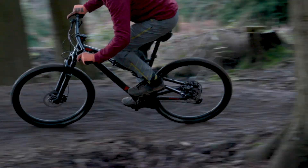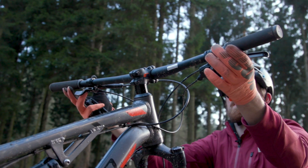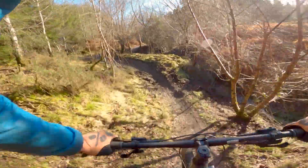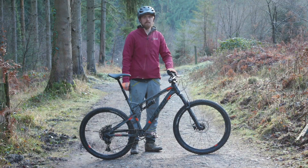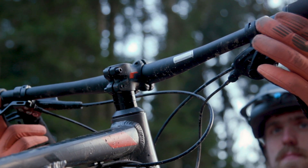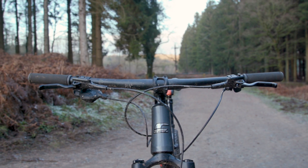The fourth step — and this is often overlooked — is bar roll: that's how the handlebar sits in the stem. If you have your bar rolled further forwards that will generally encourage you to have your elbows higher and bring your weight a little more forwards on the bike, which is generally considered better for flat cornering. Whereas if you roll the bar back so that the ends of the bar are more horizontal, that will generally be better for steep descents — but really it's about what feels most comfortable with your hands and wrists. To check your bar roll, line up your eye horizontally with the handlebar and roll the bar so the grips are just pointed slightly up from horizontal — I find that's a really good place to start.